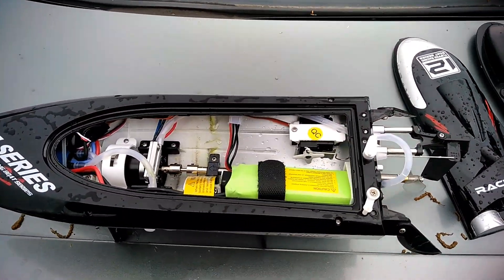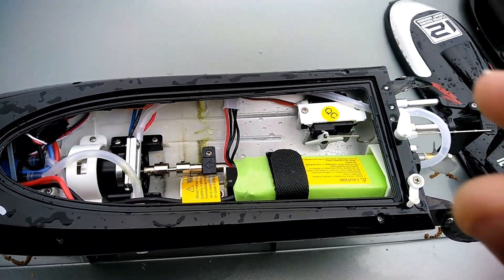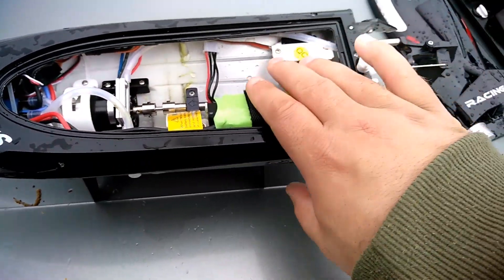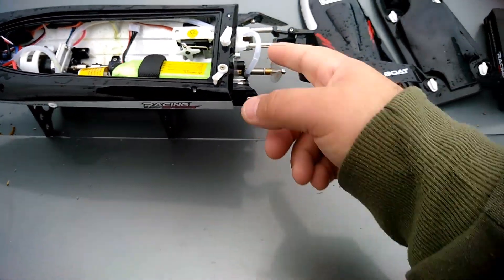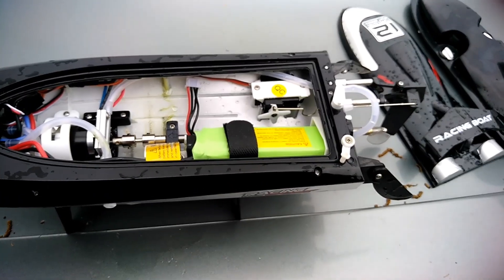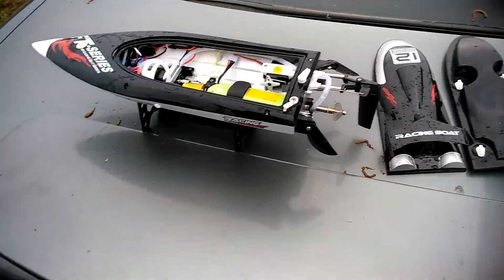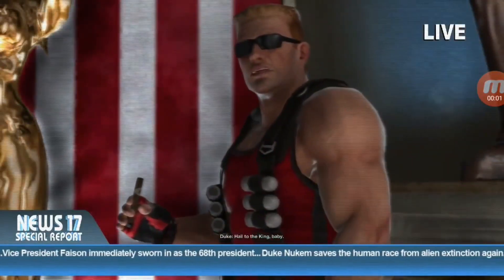We had the smallest amount of water in there, and the grease I put on the drive shaft has kind of sprayed itself out — we'll be able to wipe that off. There was barely any water — maybe that much in a cup. The cooling system works great because the motor is just basically warm. The battery is pretty hot, but the motor itself is just warm. You can see there was water all up in these lines — it was doing very well, there's still water up in this line. Excellent run time — I was very surprised. On a 3500 kV motor that's a pretty impressive run time. Alright guys, Drone Worship from somewhere in Tampa, Florida — toot-a-roo, hail to the king baby!